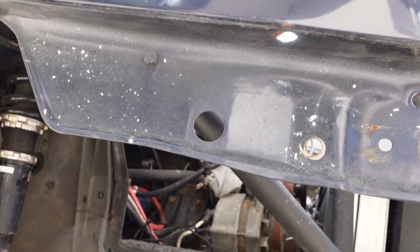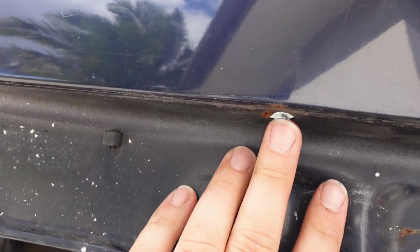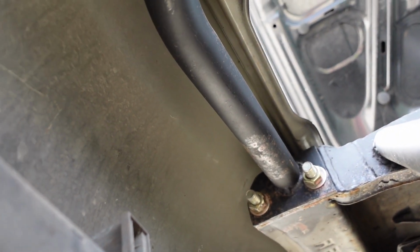I believe they're there to hold the bar on. We're going to have a detachable bash bar on this thing, so I won't need to hold the bar up with this guard. So I'm thinking I can make a plate that runs across there, on the inside of course, and we can put two bolts on it and then weld that plate to this part, which is the detachable part on the front here. I think that's what I'm gonna do.